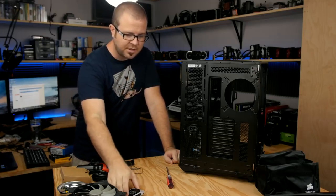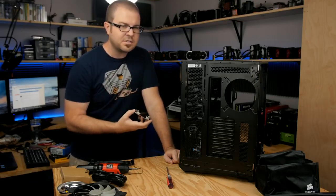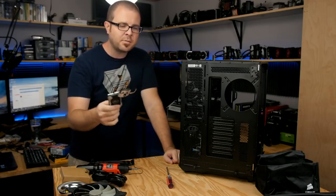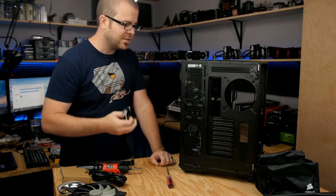So basically you need these bridges so that as it's operating at higher frequencies and especially communicating at resolutions like 5K and above, that timing stays exactly dead on, operating at, I believe, 650 megahertz, as opposed to the old 400 megahertz, and that's why they say you need these.